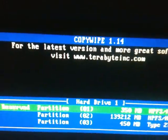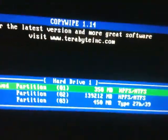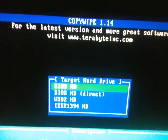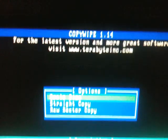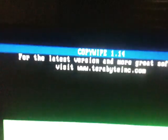My source hard drive is going to be hard drive one, because if I press F6 on that one, there are all my partitions — and that drive is full, believe me. Windows has been giving all kinds of grief. So hard drive one is my source, the target drive is BIOS HD hard drive zero, and I hit 'scale size' and confirm to begin copying.